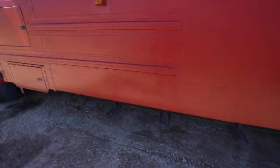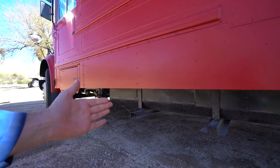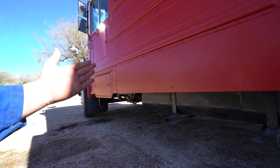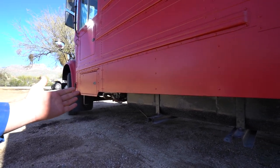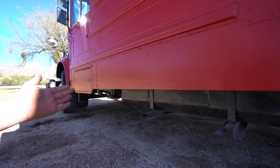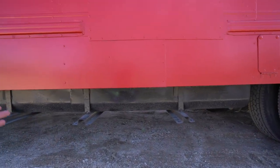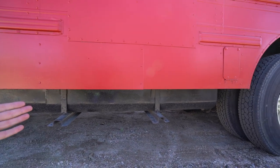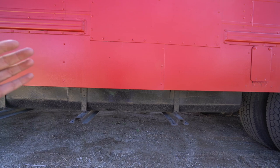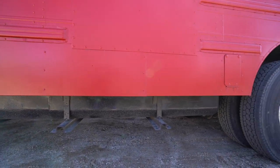Let me go into a little detail. The oil has been clogging my filter on the way to the engine — every 40, 50 miles or so it chews up an $8 or $9 filter. Still saving money compared to diesel because I got it for free, but for some reason the oil that I put in the tank was not clean enough.